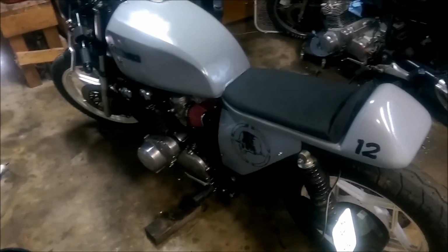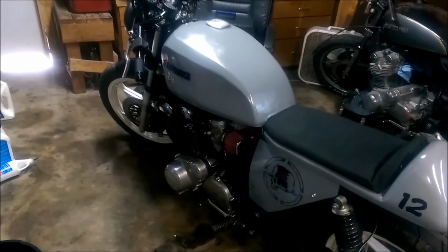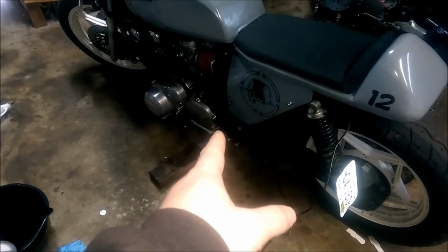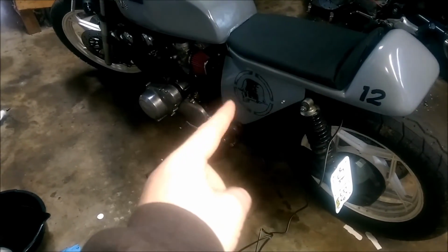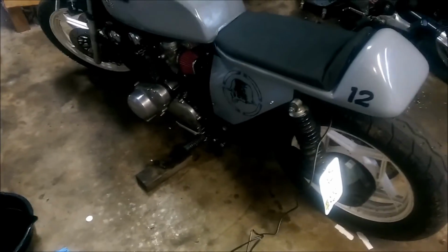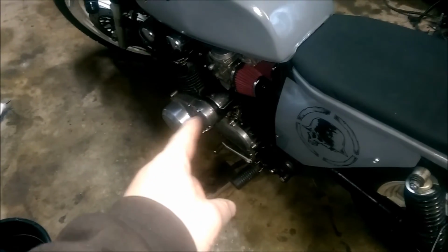So, just got my battery charger hooked up because it's really cold out, and I don't plan on riding for a while. I've got stabilizer in the tank, and with my engine, I'm thinking that there might be a gasket out inside there that separates the drive over here, because this side you pour in the gear oil for the rear drive, and the other side is for your engine and clutch plates, and I think the transmission's all on that side too. I think I got some kind of gasket out in there, because whenever I park the bike, I'm getting a lot of dripping under it from the gear oil, and I was thinking I overfilled it, but I really don't think we did.